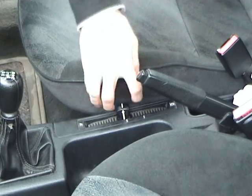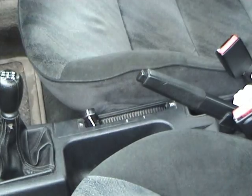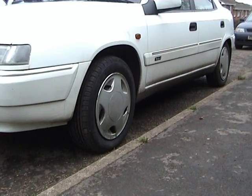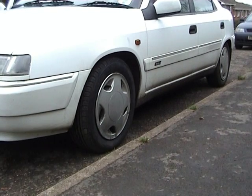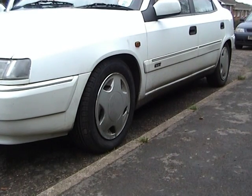Now we'll put the car back into service low. It is generally a good idea to keep the car in service low when it's going to be parked up for more than a few hours, as it at least gives the height correctors a little bit of exercise on start up to prevent them from seizing up in the long run.